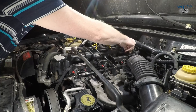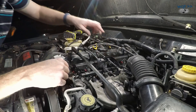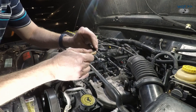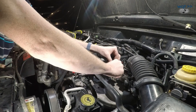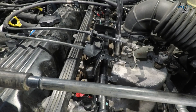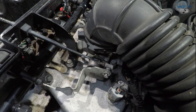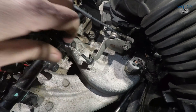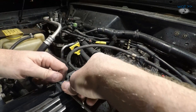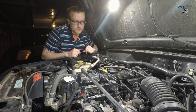Good enough and easy to spot. Last of all, just got to get the throttle cables reassembled. These are steel bolts into an aluminum casting, so anti-seize is recommended — not only to keep them from seizing up, but also to keep them from galling when you first start them in. That one snaps on this way, and this one hooks on. My last step of the evening is probably going to be to take a low, slow drive with a fire extinguisher over on the seat, and just make sure everything is still kosher as the engine heats up.